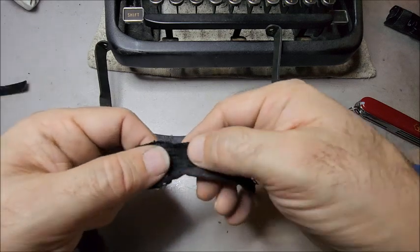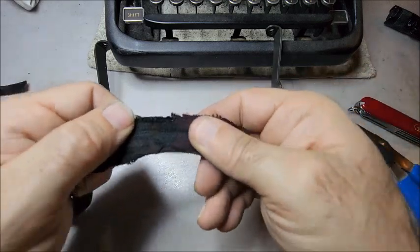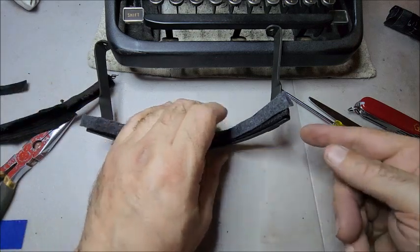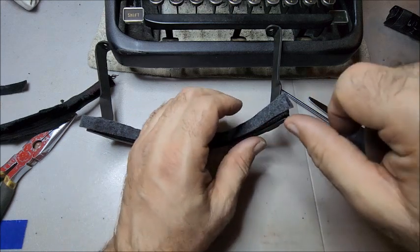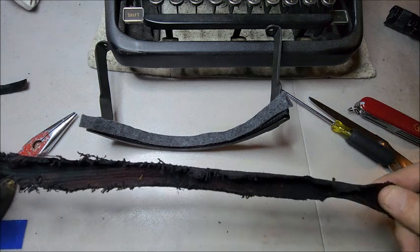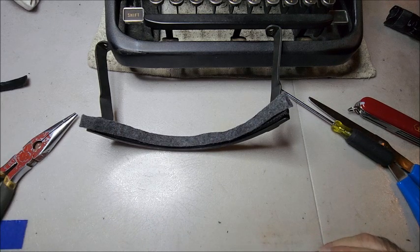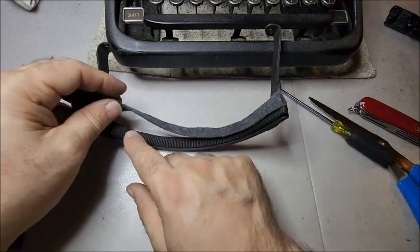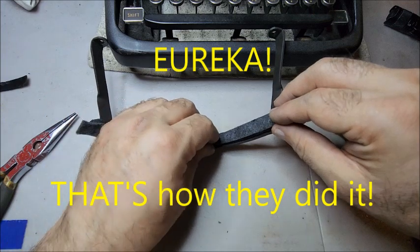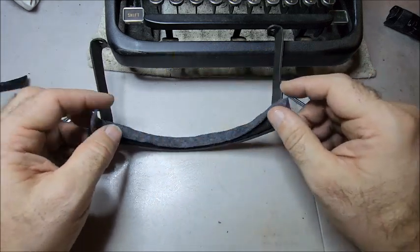And I really wish I could have just turned this around, but now that I know better how it's assembled, I could have done that by pulling out the other bits, the strips of metal on the other side of the hook, and turned that around and then put those back in. So that probably would be the better fix if I decide to do this again. So keep that in mind. Don't pull the hook bit out, but pull the other strips of metal out and then put them back in one at a time. It'll be a little hard to work them in, but it will do the job. Then orient the clip end where you want and put the others back in.